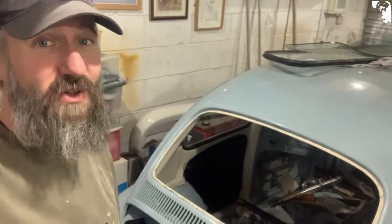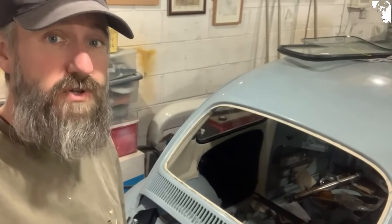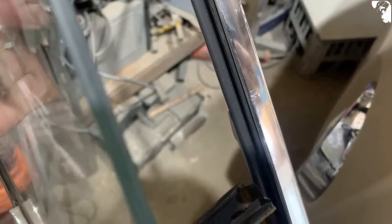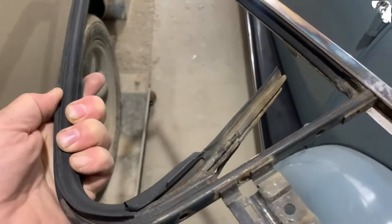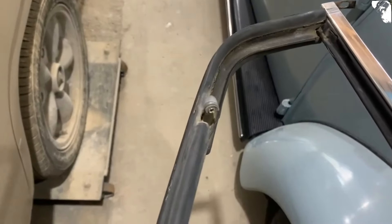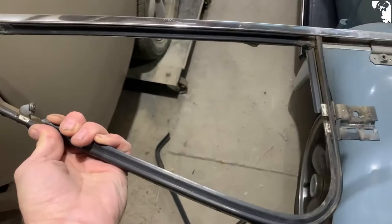That's one side on, but I've scratched the paint down there. A little bit of a costly mistake with the rear window — I did attempt to get the glass in and the trim. In doing so I actually mangled the trim up with a hammer. I was trying to give it a little bit of persuasion in the corners and dented all the trim up. I couldn't get the window out and I wasn't happy with the trim — I couldn't live with it. I had to cut the rubber out because I just couldn't get the glass back out again. So I've reordered some chrome trim and a new seal.